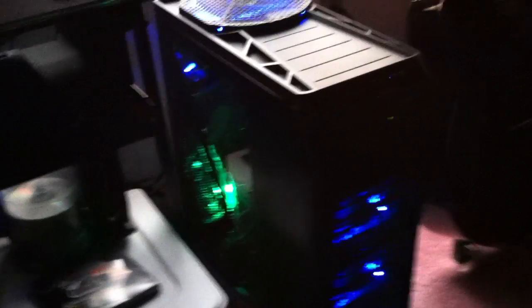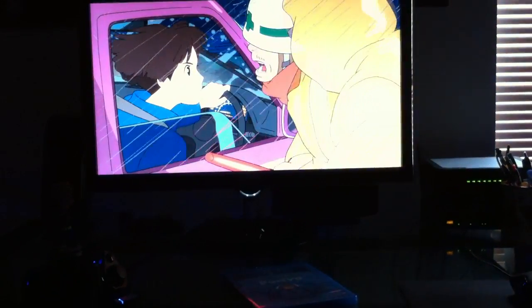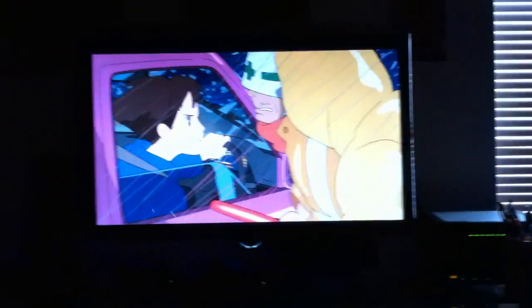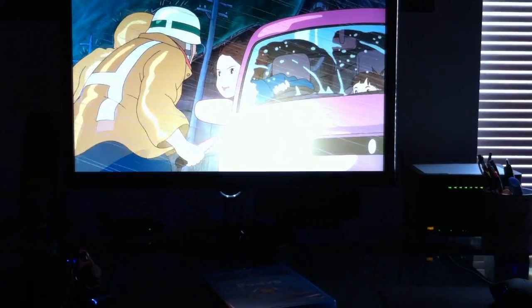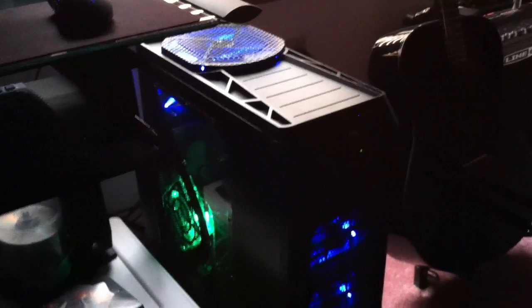All in all, it took me about four to five hours to put together. So far, everything's been great. Crossfire's working great. I have the liquid cooler set up as an exhaust, so it's taking air from the case and pushing it out. I did so because the ports for the video cards sit right underneath the radiator, and I felt like all that hot air blowing out of there would just blow up and get sucked back into the case through the fan, so I set it up as an exhaust.